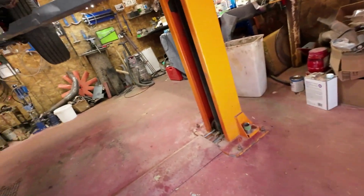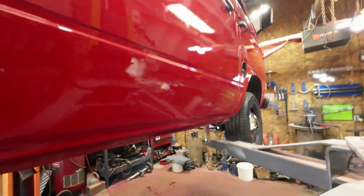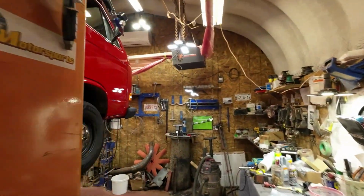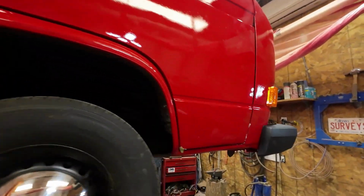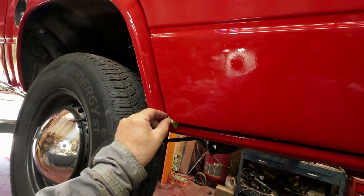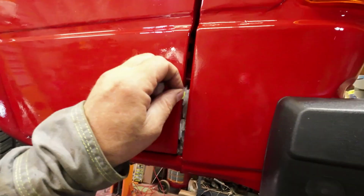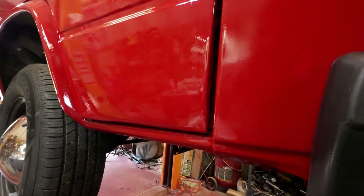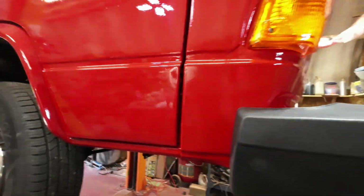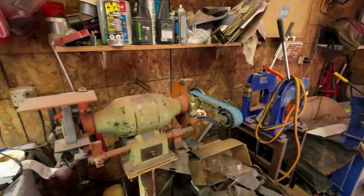Anyway, first I'll let it down and line up the wheels. Do a wheel alignment on it so that it's pointing the right way, and then tighten up the tie rod ends, which is a good idea. Look at that, more tape. Tape everywhere you look. Tape, tape, tape. And I don't know what this is. Plastic. Okay, that's out of there. Wet plastic from the rain.